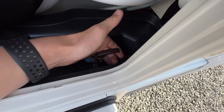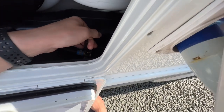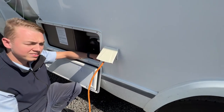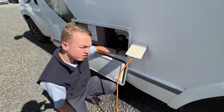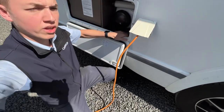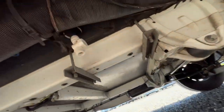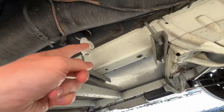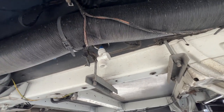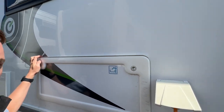The travel drain allows all the water out except for 20 liters, so you've still got enough to use your toilet and make a cup of tea. Lift that up, have the pump on and you'll see the water coming out of the van, draining down to 20 liters. However if you're winterizing and want all the water out, or need to drain contaminated water, come underneath the van to your main fresh water drain point. Turn the white nozzle to allow the rest of the water out. In winter, make sure this is fully drained and the valve is left open to avoid water freezing and causing damage.